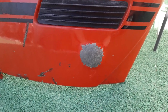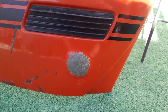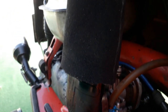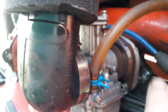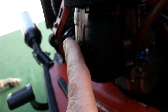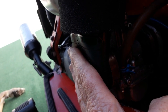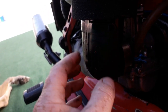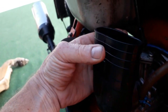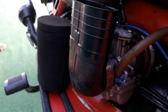I'm going to make an insert for the rubber to stop it collapsing — that's my next project. This is my rubber intake. I've got my manifold as short as I can get it, but even with the side panel on, it was completely flattening it. Once it gets hot it just sucks in. I've modified the outside of the panel to cup around this part, and now I'm going to make something that fits inside to hold the rubber rigid and stop it from collapsing.